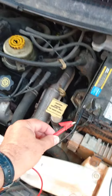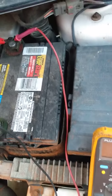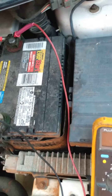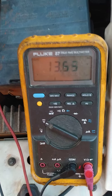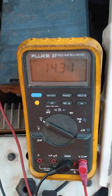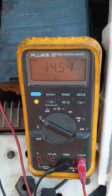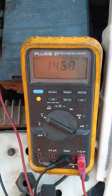But if I take this little plug right here, that's connected to the back of the alternator, and touch it on the battery positive, you'll see what happens on the meter. You can hear it kind of dragging the engine down. And you see it's going not quite full field, which would be probably 16 or so, but it's going 14 some. So clearly the alternator works in this case.